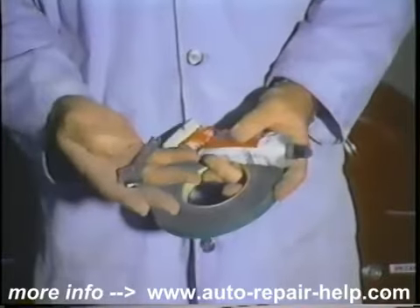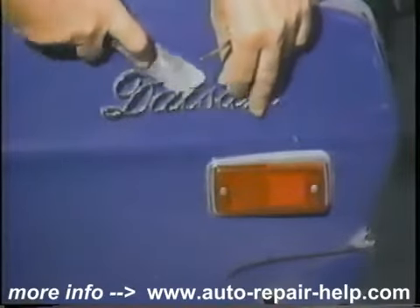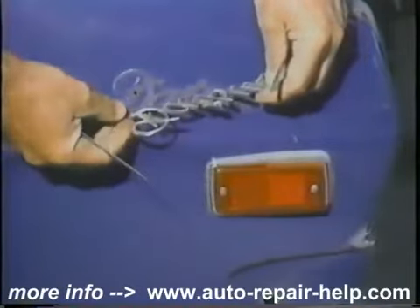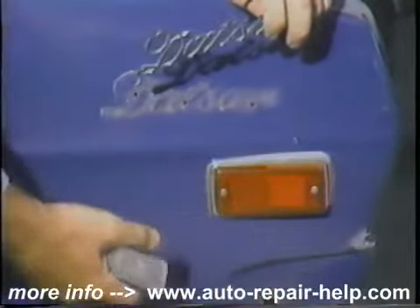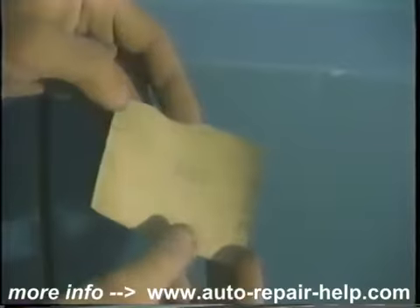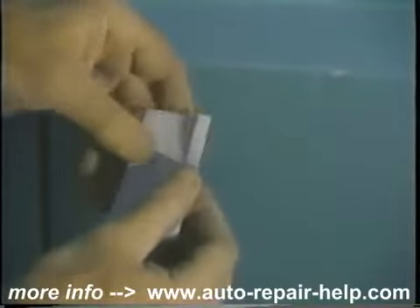A wrench — that's all you're going to need to put all these things back on. And one more other kind of molding — a trim piece that just presses in. Your putty knife will help you determine how they come off. Take out the Phillips head screws and lift off the side light. Now we're going to take a piece of 100-grit sandpaper and just go around and scuff up all the door dings, supermarket cart scratches — that kind of thing. It really detracts from a good paint job. Just take care of all those little imperfections. With the car clean you'll be able to see them.